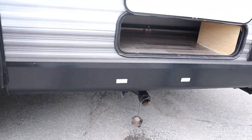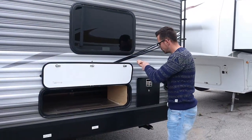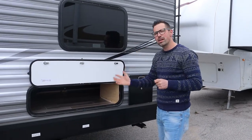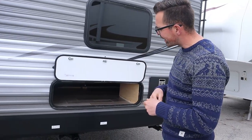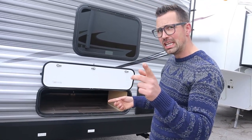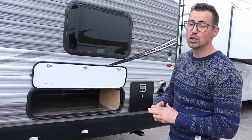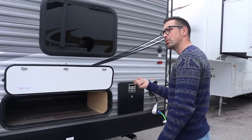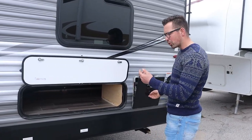The J-Flights have a black water flush kit; the J-Flight SLX does not. If you're using it, hook the hose to the black water port with the black water gate valve open, then turn the water on — it sprays down the inside of the tank. It is extremely, super duper important that your black water gate valve is open when you hook up the black water flush kit. The location varies by floor plan but it will be labeled.